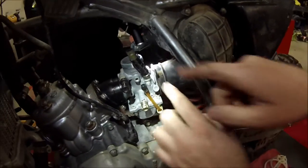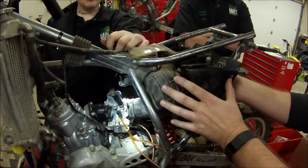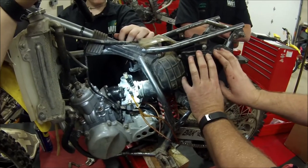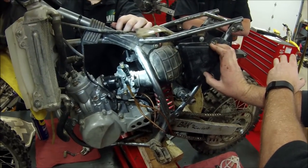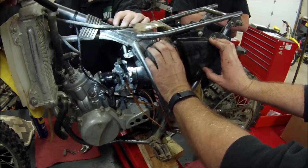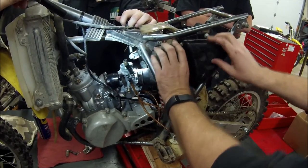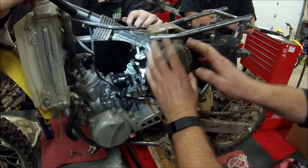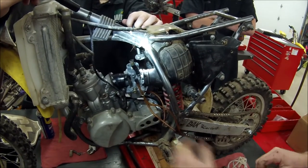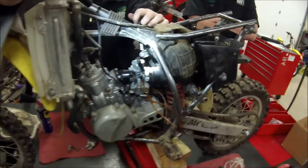If you're having a hard time getting this to seal, what about loosening the airbox mounting bolts? There could be a little play in there. People forget you have some flexibility in moving the parts around. We took this airbox off to clean it — this is a 2003, and this rubber has shrunk and deteriorated a bit over time. If we pull it from its stock mount it's not necessarily going to fit perfectly, so massage your parts and move them around to where they fit really relaxed. We don't want to put preload or tension on any mounts — especially on a two-stroke that's going to vibrate.